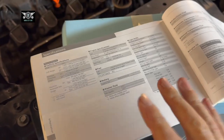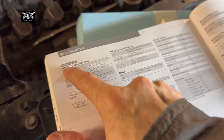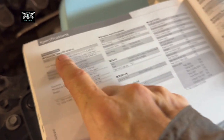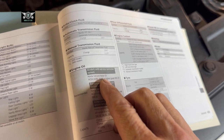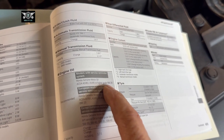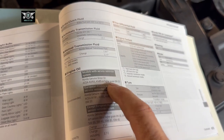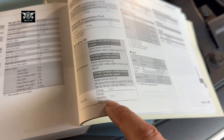Now the manual. Looking at the manual here, just make sure you check — if you have a petrol car, make sure you look at the petrol engine specifications. If you have a diesel engine, obviously you have to go to the diesel section. So petrol engine, oil, recommended oils and levels: ACEA A3/B3, A5/B5, grade 0W-20 it says there. The capacity is 3.5 liters if you just change the oil, and 3.7 if you change the filter as well.